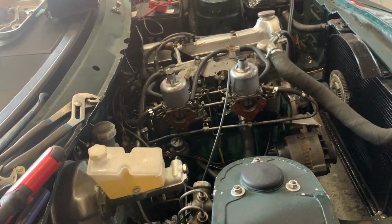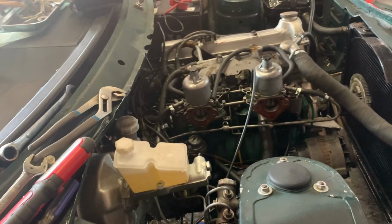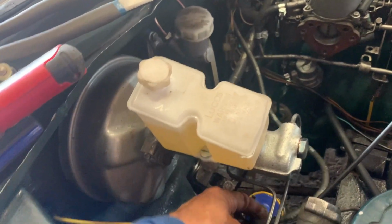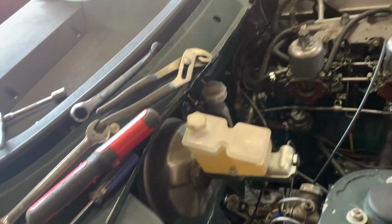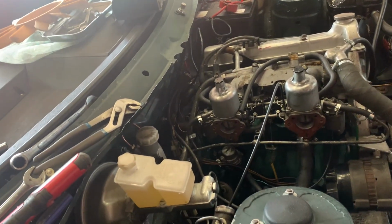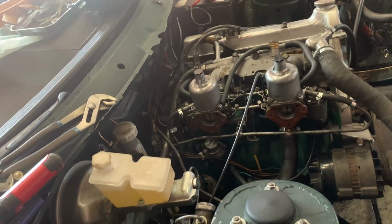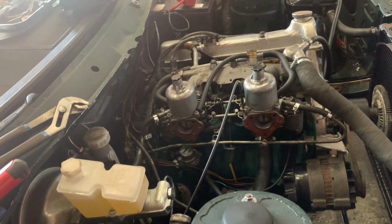Now I can start looking at, well, get an exhaust on there, get the fan back on, air filter, all of that. Get the coil in place properly, go through and tie up all of the electrics, put in a proper petrol tank, rather than doing it like that. I put the tank in, I just need to put the cabling, the piping in. And so, future episode, we'll stop here on the success of it actually running.